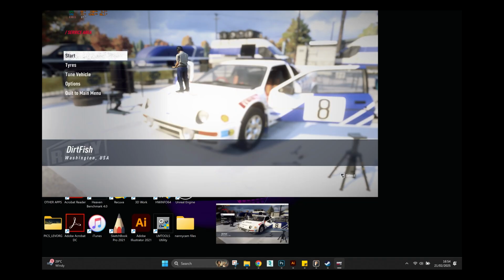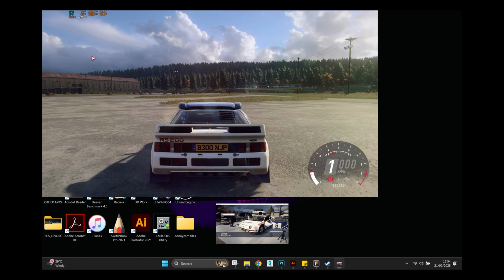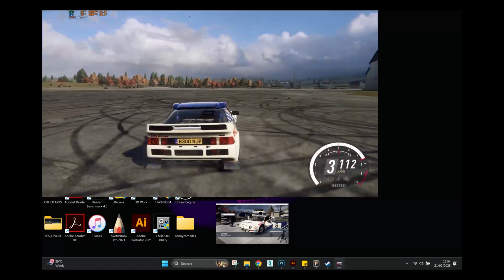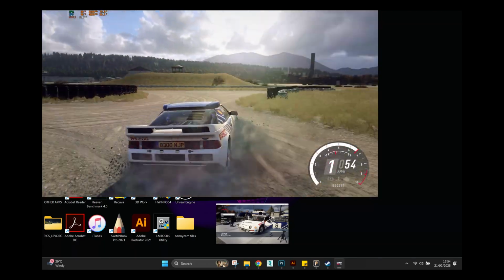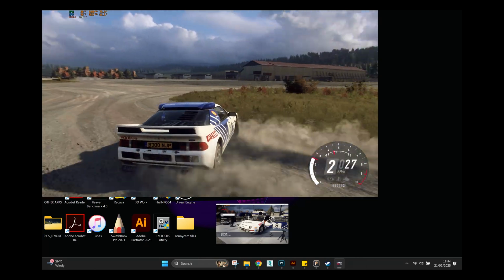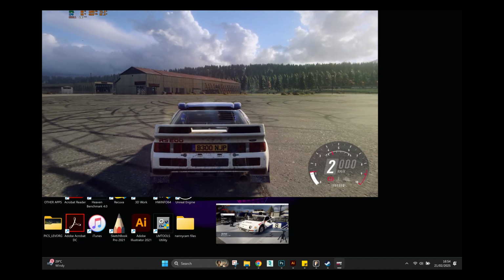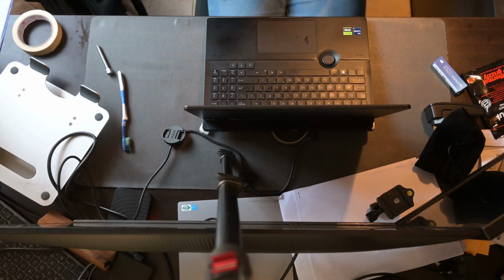Yeah. Here we have a game that I'll also use as a real world test, where we are just checking the overall temperature and general stability of the game, and the power outputs. After some time with this game in particular, this is actually quite an old game, I think a 2019 or 2020 game, the CPU isn't heavily taxed with this title. However, after maybe 5-10 minutes, the GPU has hit its thermal throttling target, which is around 87 to 88 degrees Celsius, which means that now it starts throttling back on its own clock speeds and other critical factors that will in turn affect the performance.